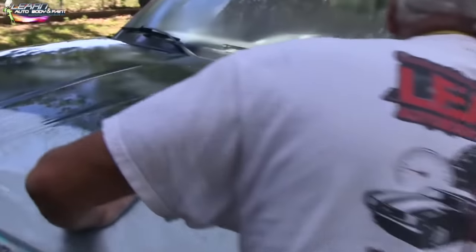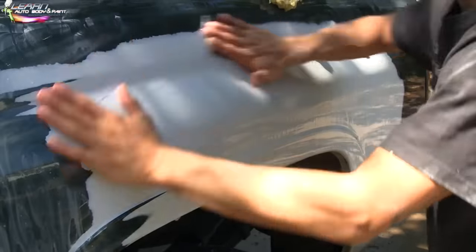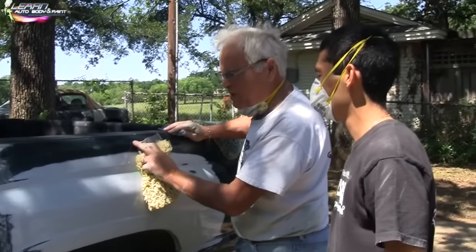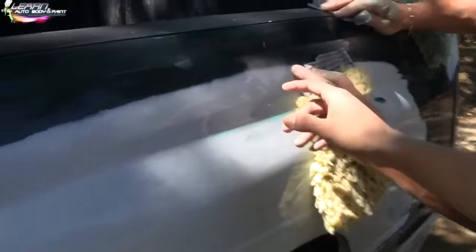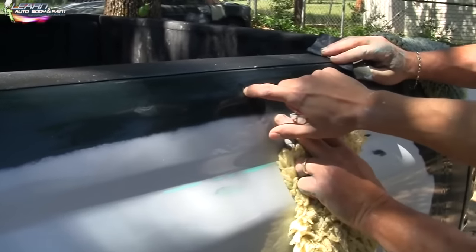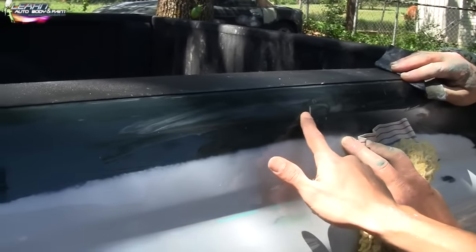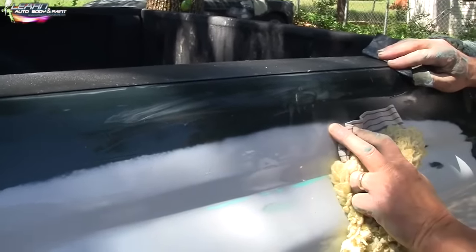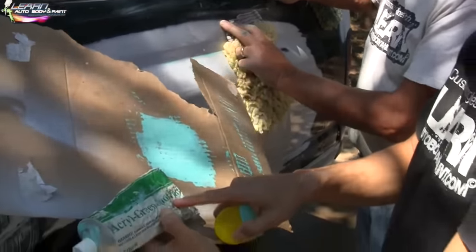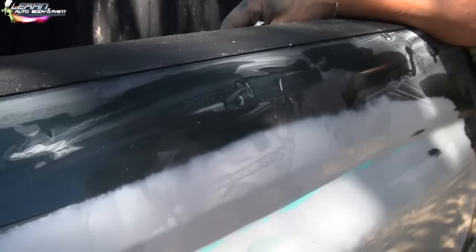You can see I'm washing everything down with a 400 grit, getting it ready for paint. Say everything is done and ready for paint, but we missed a chip here — a gouge. What do we do? It's not too late. All you have to do is make sure it's dry, then use something called spot putty — a polyester spot putty. Put it on there, let it dry, block sand it out, and you're good to go.